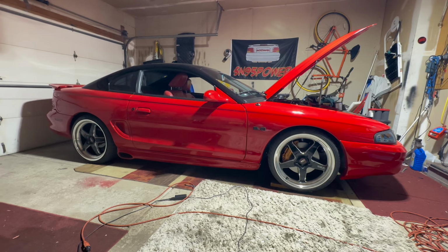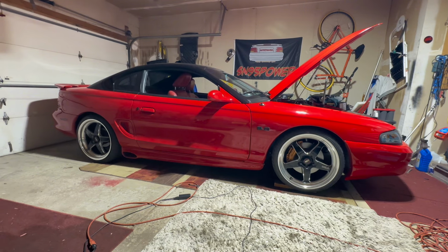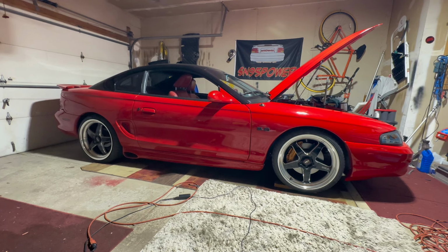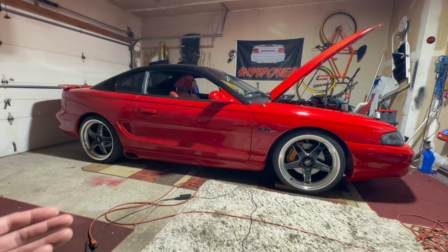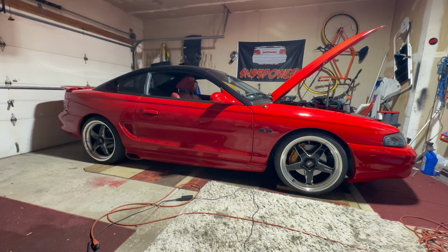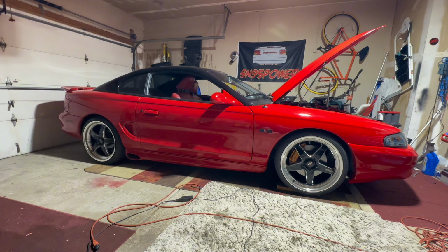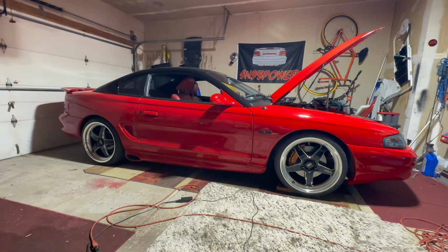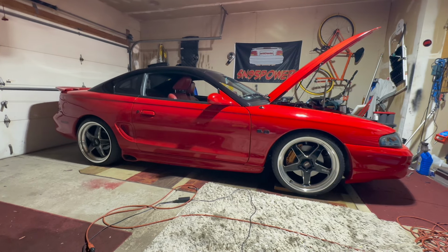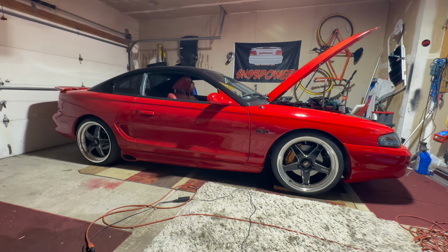By the time I put that effort into doing that, I could have switched the stock radiator back in, which I know is good. And sometimes the stock radiator is better. It's a less dense radiator, less area that the air has to flow through as opposed to a three row. I don't know if I'm going to go back with a three row radiator after I do this. I honestly think with a two row and these fans, I'm not gonna have any issues. It's just, something isn't sealed in the system, man. I just gotta switch the radiator. I think I'm 95% sure that's what it is.